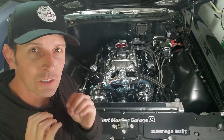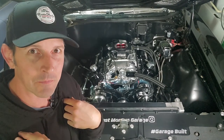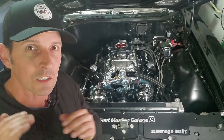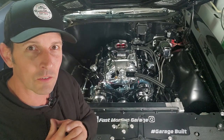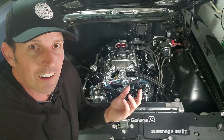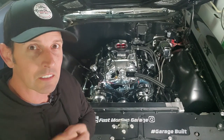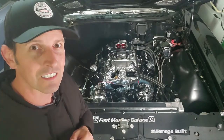Obviously go through every connection and make sure they're tight. Next episode, I'm a bit concerned about the Holley electric pump - the instructions say to mount it within 12 inches of the bottom of the tank and I'm probably at 13 inches. We'll fire it up and see how much noise it makes, since we're making videos in the car. Subscribe if you haven't, because next episode we're going to fire this thing up. Build them fast, drive them faster - see ya!